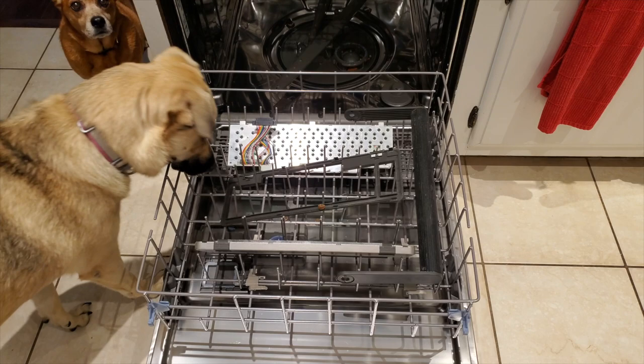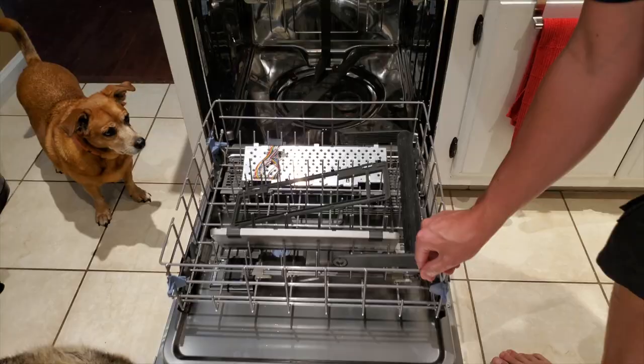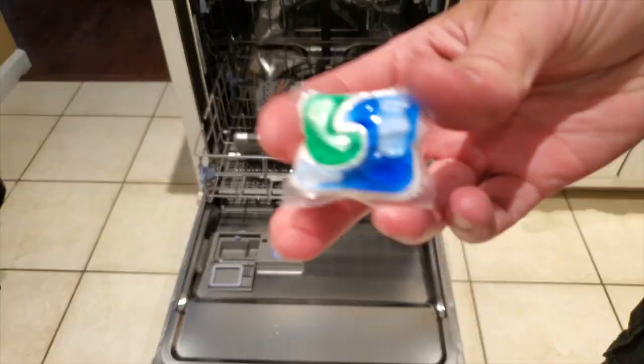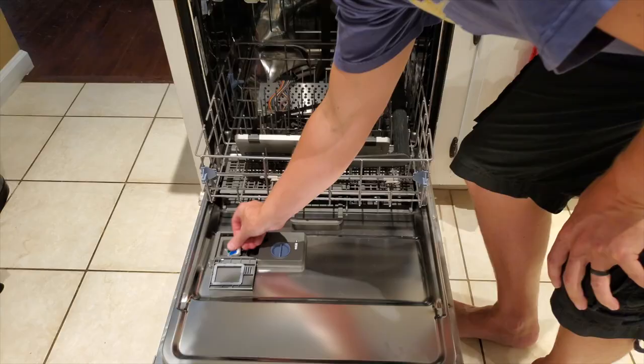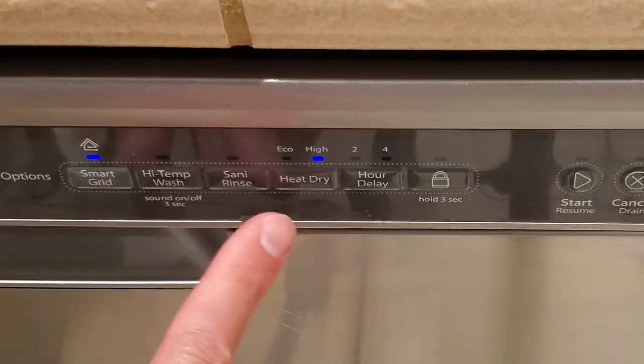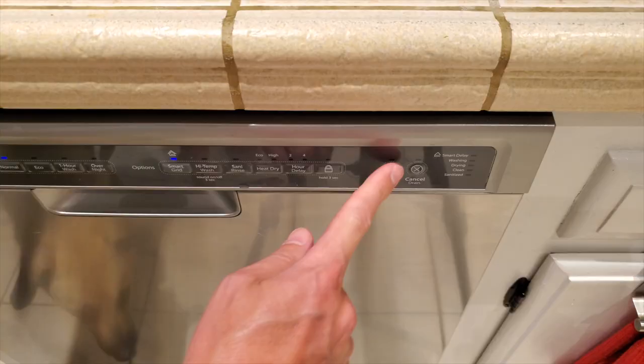And now everything's passed inspection, I'm going to throw in a standard dishwasher capsule. Contrary to what you might think, it's absolutely fine. It even contains anti-corrosives, intended to protect your silverware, that will actually protect the metal parts inside, including the keyboard springs. Just make sure you turn heat dry off so nothing melts.